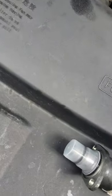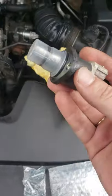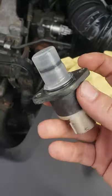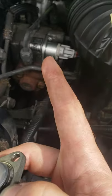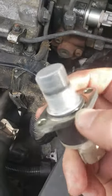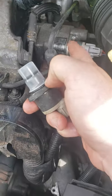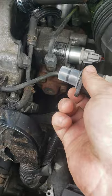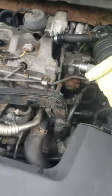It comes with a few pieces. I didn't seem to need to replace the nuts or bolts. It also has another gasket in there, but mine was pretty fresh as I'd replaced it a couple of months ago. This is the faulty item — the suction control valve. As you can see there is a rubber O-ring, sort of hard to see, just attached to it there, and that comes with the new one. So unplug it, fit your new gasket if you wish, put your new O-ring in place — that'll sit nicely in the housing beside your gasket — pop the new one in, put your two new nuts on, and plug it back in.